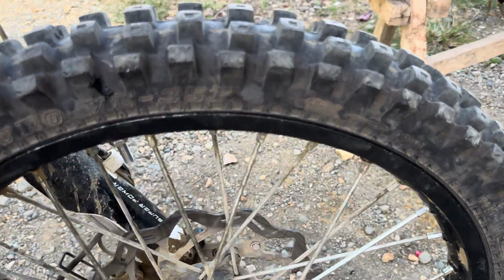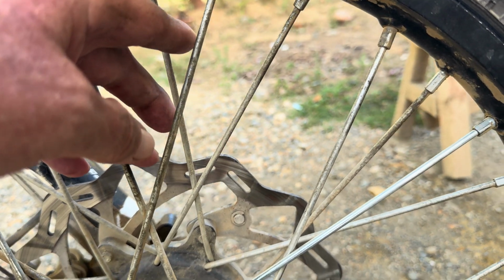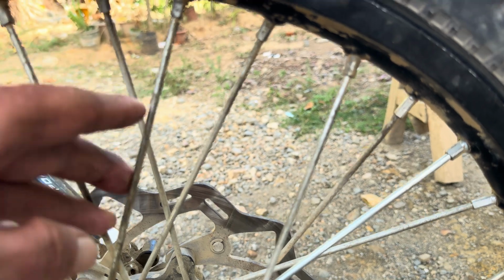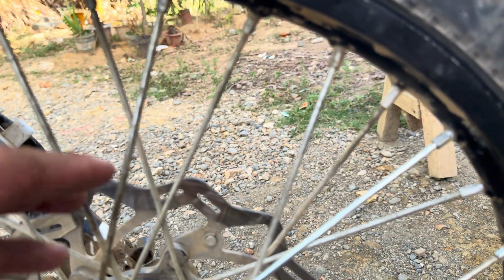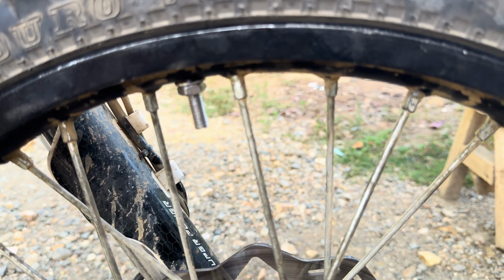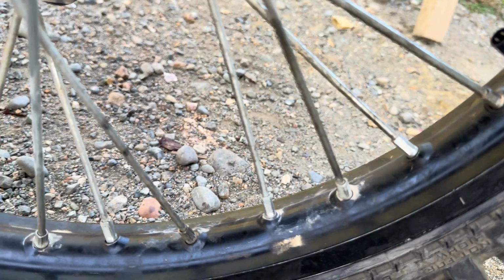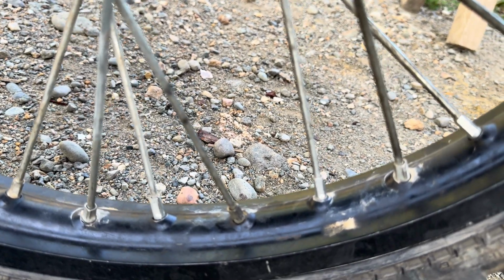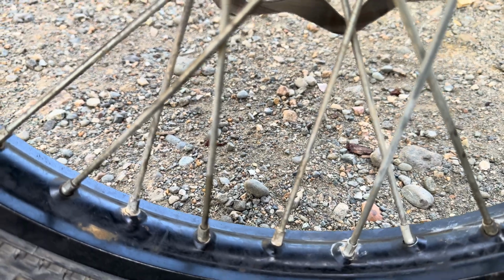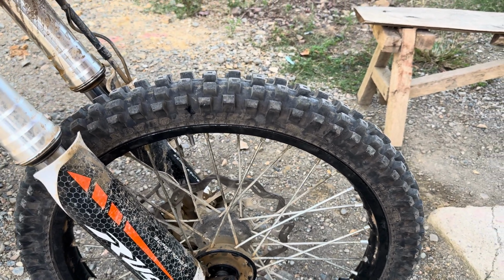And the way you put your rim locks in, if you see here, if you put a rim lock in there, it'd be hard to air up if it was a lock or the air valve. So every 4 spokes on a 36 spoke rim, I call it the key spoke, where it's wider here and you can easily put something in. So that's what I've done there. That's the way you want to decide where a rim lock's going to go. So you've got your valve, 4 spokes, and there's an opening there, a little wider, 4 more spokes, another one. Since I was going with 2, I'll let you know how that works out.